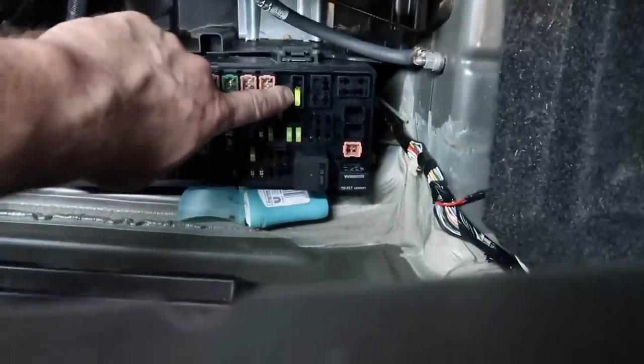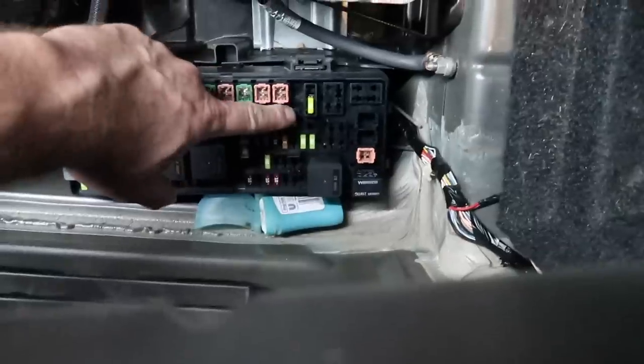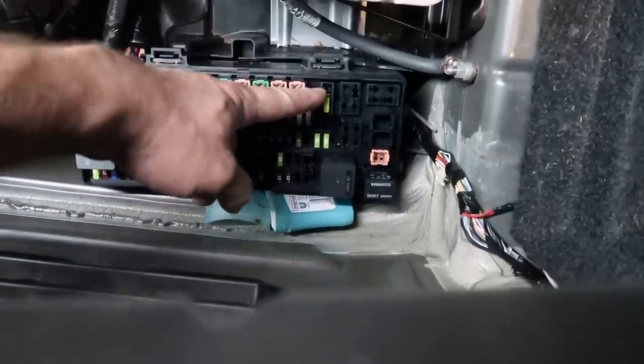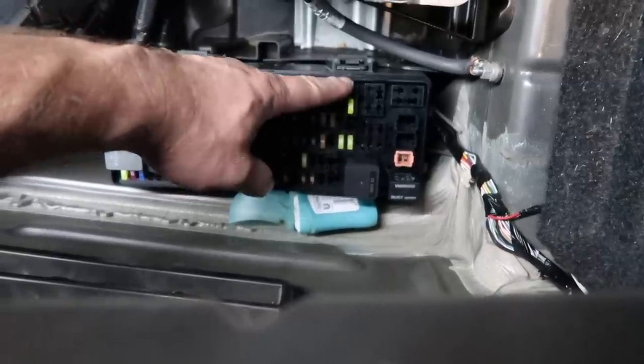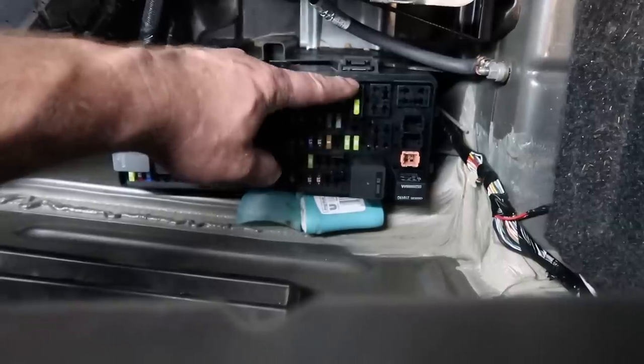We'll feed them into our high-level to low-level. We're using the LP7-2 or DOT2 PAC Audio high-level to low-level adapter because it has the auto turn-on. There is an accessory turn-on located in the trunk at the fuse holder. This fuse right here is the power outlet fuse — if you notice, there's an open hole. The middle one is a common, and on one side is constant 12 volts and on the other side is accessory. That way when the audio shuts off the amp will shut off — it'll act more like a true remote turn-on.